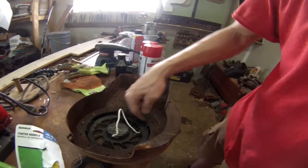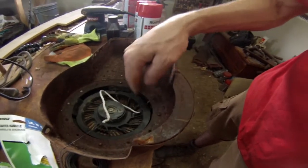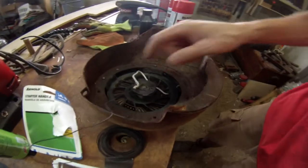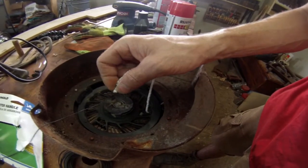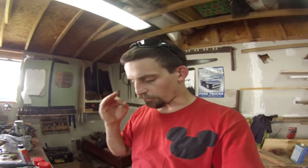I'm trying to put the pull cord back into this reel. I was having a really hard time getting it through both holes since it's all riveted together — I did not want to cut those rivets apart. What I ended up doing was using a piece of picture wire like a fishing line. I threaded it right through the end of the line, then looped it back onto itself making a little hook, so it would pull right through the hole without bunching up. I tried just hooking it on its own before and it bunched up at the smaller hole. Threading it through the end and looping it worked perfectly. Now I've got it through all the holes and I need to figure out which way to wind it.